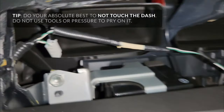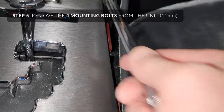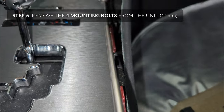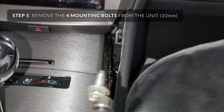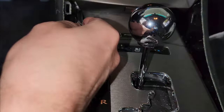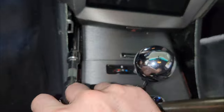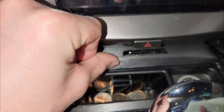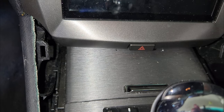The other two bolts are there, so it's four bolts total. I'm using an extension, 3/8 and a 10 millimeter. When you loosen it up in there, I'm personally using a magnetic tool to take the bolt out. But you can use needle nose if you need, or it may come out with the driver. If you drop it back there, you'll have to pop out the side panel and try to dig it out. Often if you drive back there, you can put your finger here and pull this outwards a little bit and it will fall out. The first thing you could do is wait till you pull the panel off, take the ashtray out, and go underneath and grab it — should be no issue.